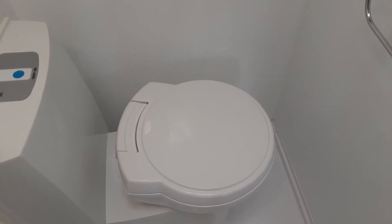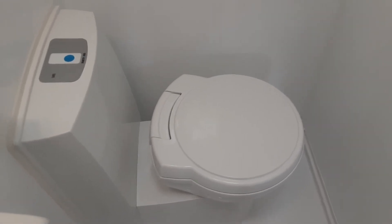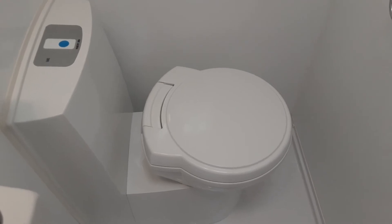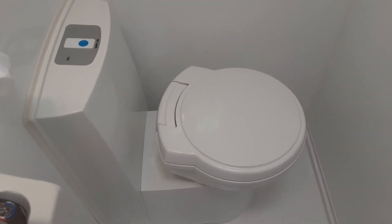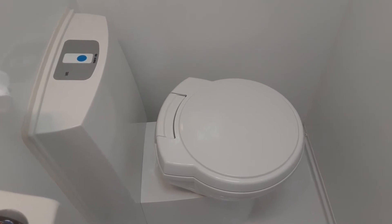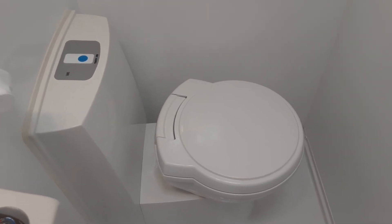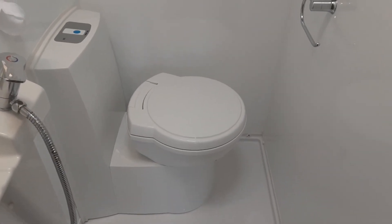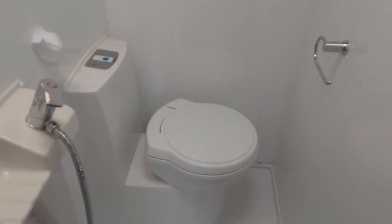However, when you are removing the toilet cassette from the van, you do need to make sure it's pointing straight across towards the loo roll holder before you try to remove the cassette from under the van. The reason being, it has two lockout tabs on it that lock the toilet cassette in place if the toilet's turned. Underneath the toilet, you have a grey waste handle which you need to push across towards the back panel of the caravan to allow the toilet waste to go into the cassette underneath the van.